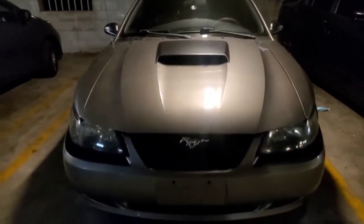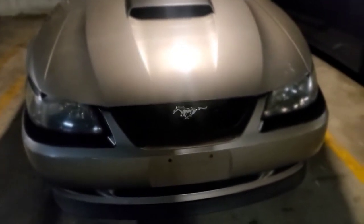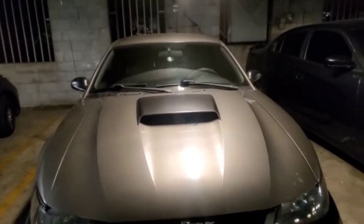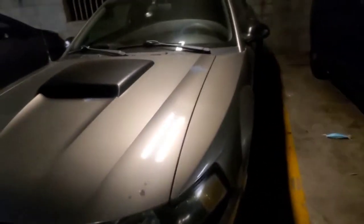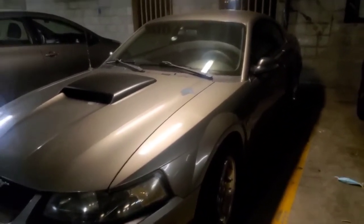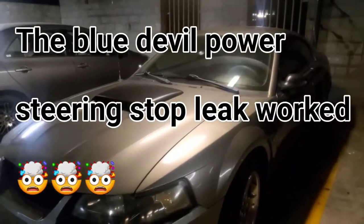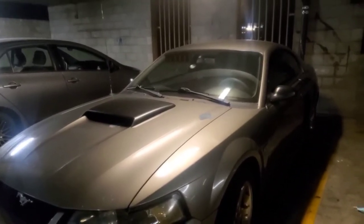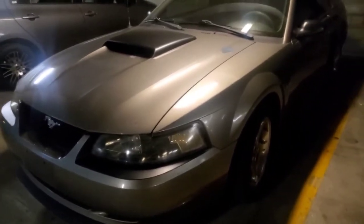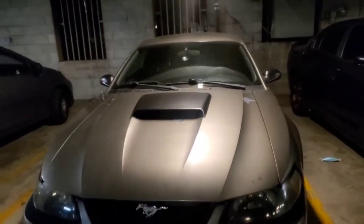Okay, it's all been said and done. New pump is on, belt's on, everything looks good — but one issue: the high pressure line is still leaking. Part of me wants to try some stop-leak, part of me thinks I'm gonna have to take it back off and put some thread tape around the fitting to keep it from leaking. I don't want to do that, it's so hard to get to. Anyway, thanks for watching — go ahead, smash the like, hit subscribe, we're out.